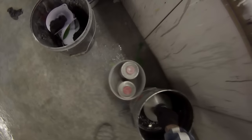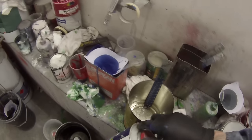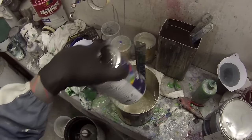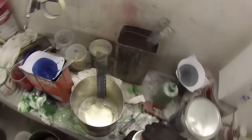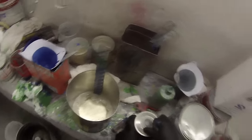You may have noticed I'm taking my clear coat and hardener out of a bucket of water. You might be wondering what I'm doing, but this is probably one of the best tricks in the trade for painting in the cold. I've just filled the buckets with steaming hot water out of the kettle — boiled it a couple of times — and heated up both the hardener and the clear coat.